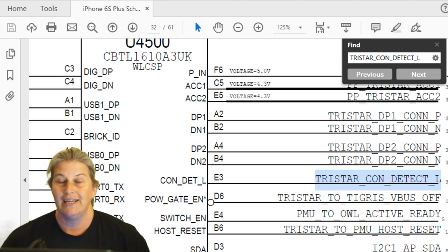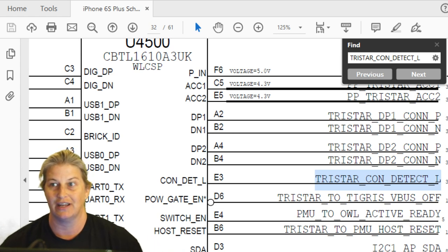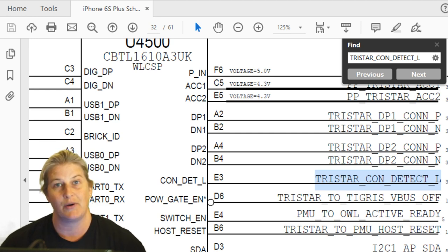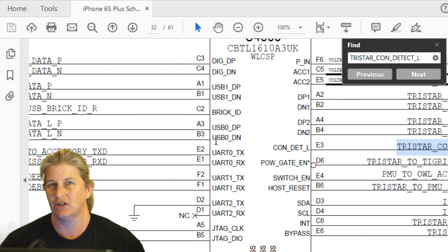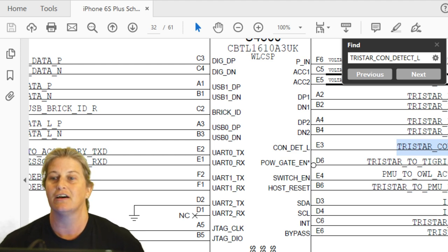So in addition to short or open, the third failure type is when a chip can't do its job even though the line isn't short or open. If we took off Tristar and did diode mode under Tristar — guess what? No shorts, no opens under Tristar either. There's not a lot of failure points between Tristar and the dock, and not a lot under Tristar either. I've already cleared that by changing the chip, cleaning all the pads, and putting a new chip on. The dock itself looks good.